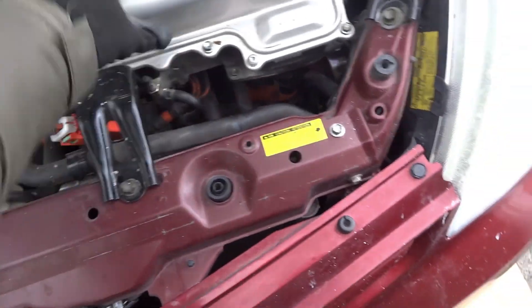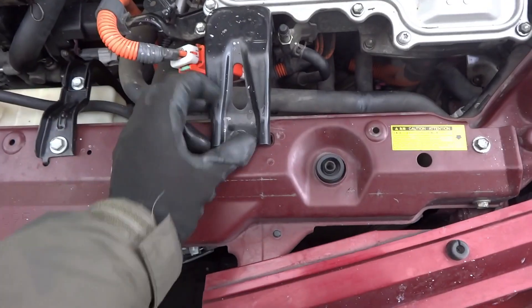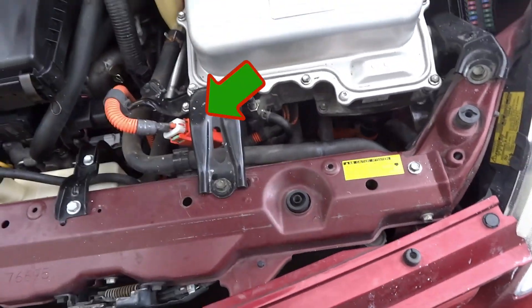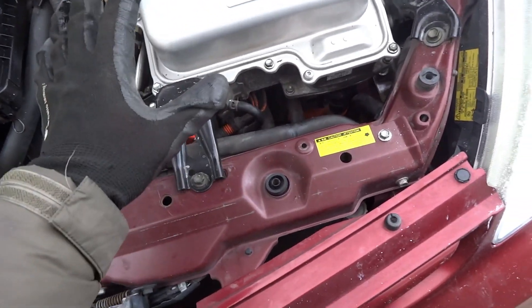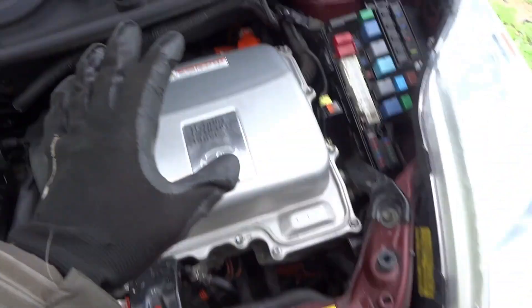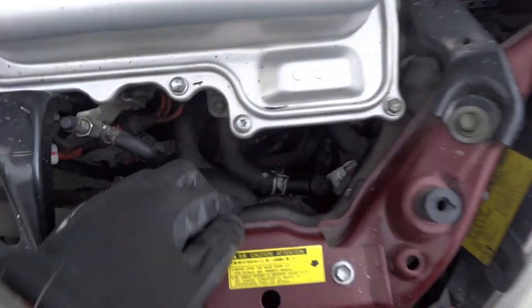This is the inverter mechanism — under here's a bunch of electrical components. Release these 12 millimeters and this you can just lift up with your hands and put a piece of wood. It's not heavy. Once you've disconnected that battery, all these orange wires, which are hot with that high voltage — you could be extra safe and remove that orange plug from the battery, but there's a set of relays in the high voltage battery that when there's absolutely no 12 volts these do not have power. You don't want to be messing with them as much as possible. I'm going to lift this piece up so that we can get better access to that pump.